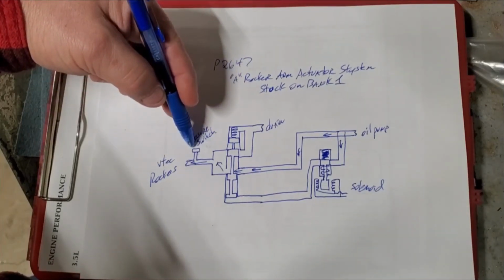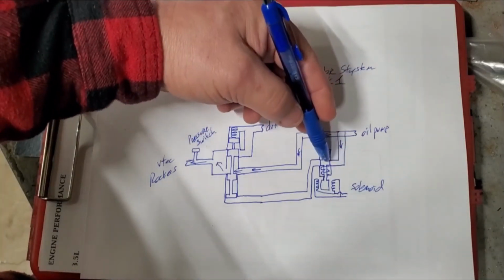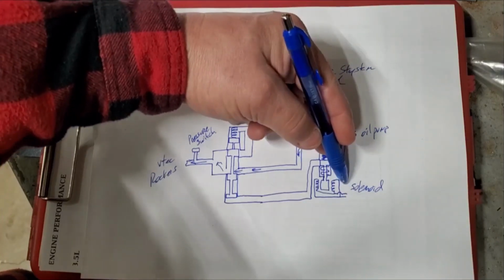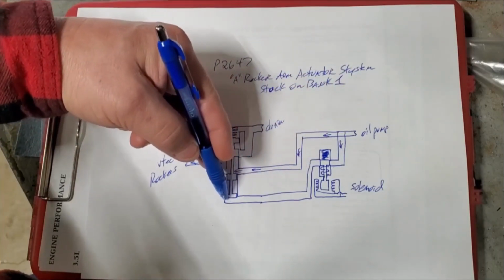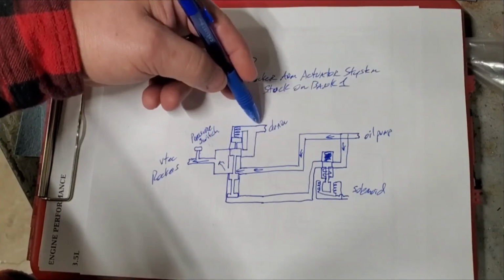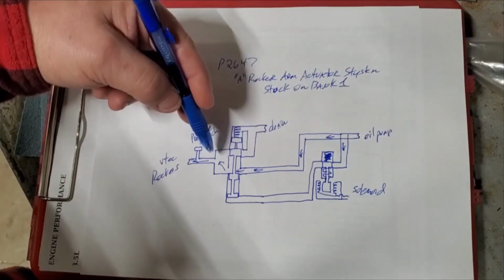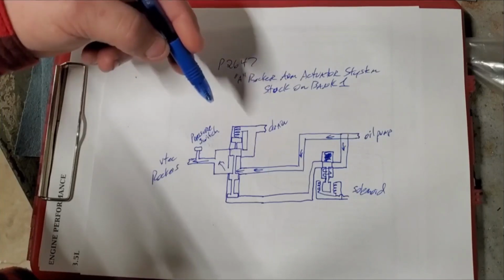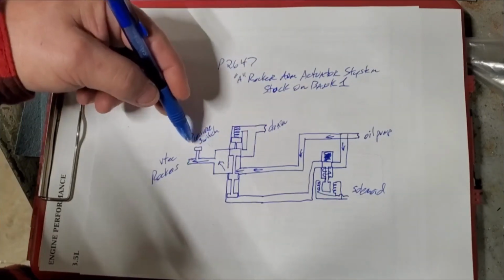And there's a pressure switch. Oil pressure is also right here at this valve, which is normally closed. So when the VTEC is energized, it goes against spring pressure and allows oil pressure to go here, which closes the oil pump supply and discharges. So when you energize the solenoid, it turns off. If you noticed in the video, when it goes to 12 volts plus on the meter I have on the dash, oil pressure rockets down on this pressure switch.